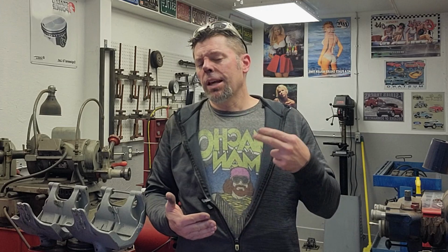And not only that, I've opened these ports up a little bit on the manifold, and something else I'm looking to gain with this tractor is, at least I've noticed it on the derby motors, when you change the ports in the head and the exhaust ports, it gives it a different exhaust tone. If I can get a different tone out of the exhaust where it has a deeper roar to it, that's kind of what I'm looking for as well.